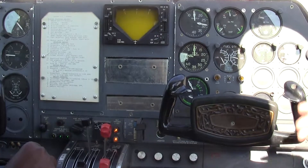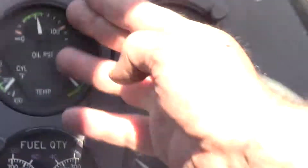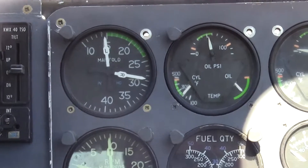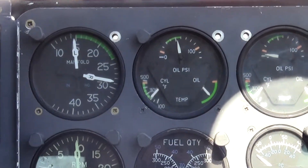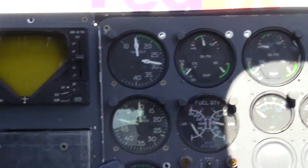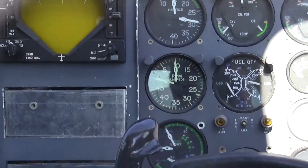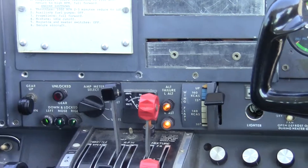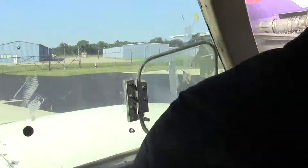So we're watching — that's the cylinder head and oil pressure and temperature for the left engine; that's for the right. We're only running the left, so that's what we worry about. We have oil pressure — point that out to me. Where's the oil pressure? It's in the green. The oil temperature is green. We're going to momentarily shut both mag switches off — down and right back up again — to see if the engine wants to die. Good. Now we know that they're not hot; they're operating fine.